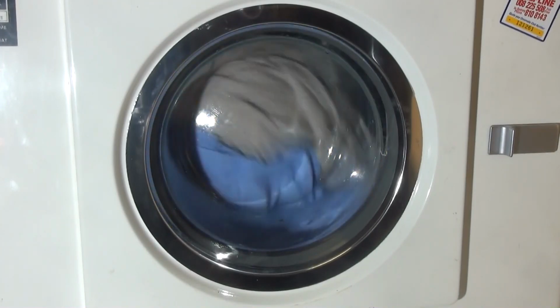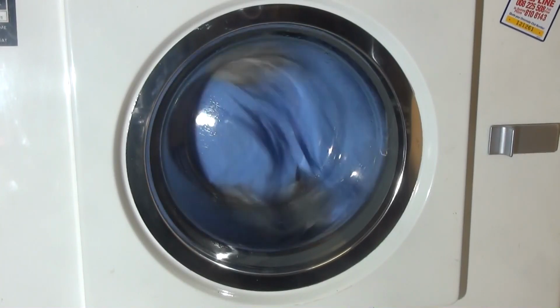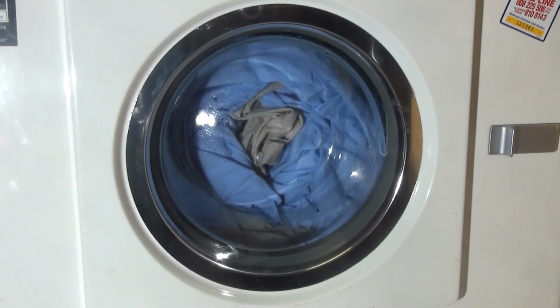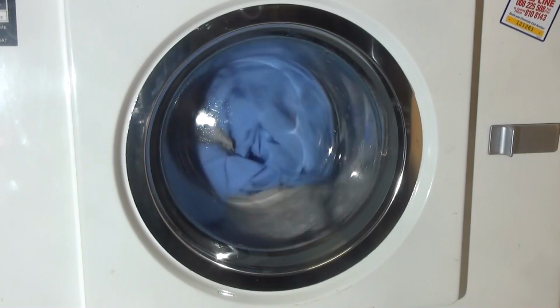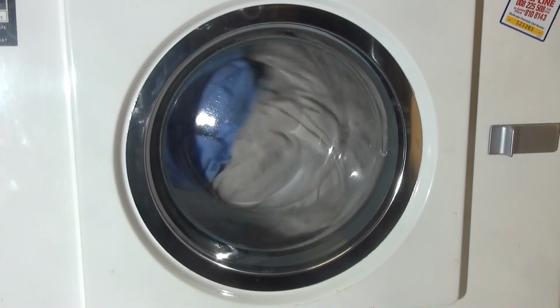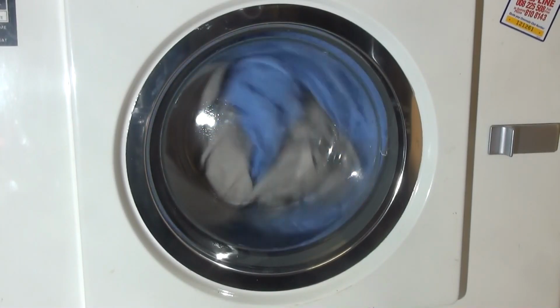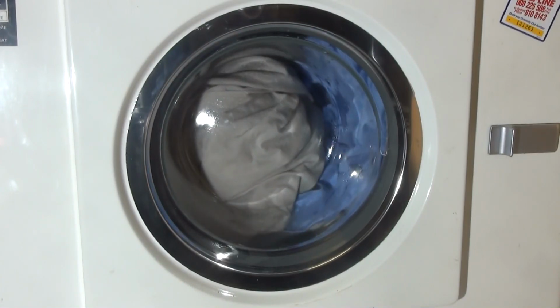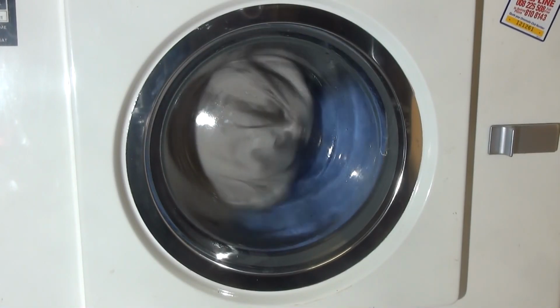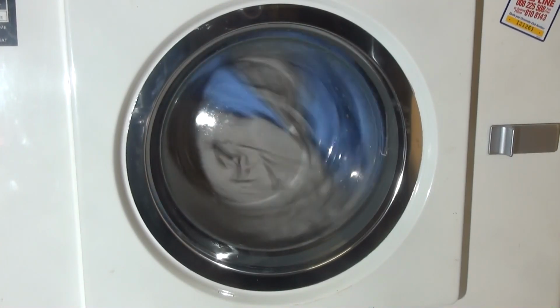The WM5100 I had, the first intermittent spin after the wash goes up to 400 RPM, and then 600 RPM, but on the intermittent rinse, the speeds between the rinses, it just slowly ramps up all the way up to 1,000. This one will only do the progressive spin if it's got a full load. Other than that, it will just take off like a vintage machine and go straight out. That's what I like, it has a vintage kind of programming, where it won't mess about getting the speed. So it advanced twice. It goes past program H to start the spin.